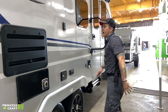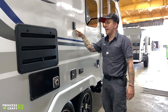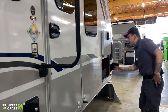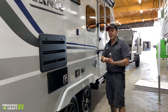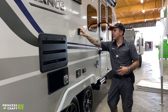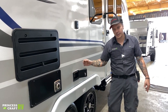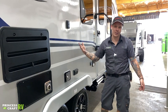Outside TV area here. On the inside of the camper, you'll find a TV mount that mounts right here on top. Seat the top of that mount first, then there's a little button to push to allow the bottom section to snap on. You'll get a secondary TV, install it to the TV mount, then apply it here. That TV is designed to be used only when the unit is stationary — not something you want to drive down the road with in place. You have power sources here: a 12-volt outlet to power a 12-volt TV, a couple of USBs to charge devices, and 15-amp 110-volt outlets.